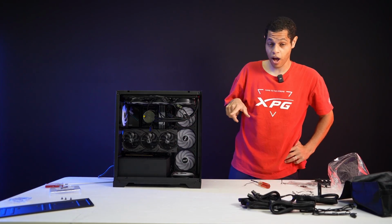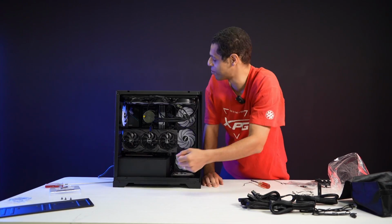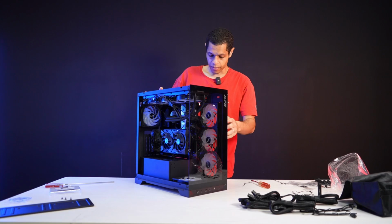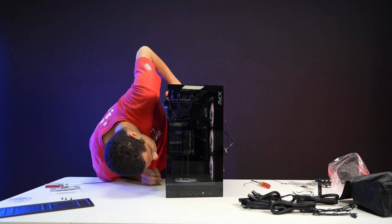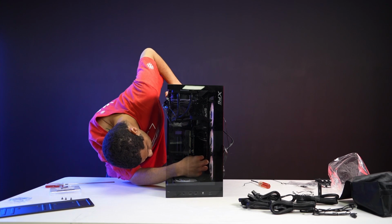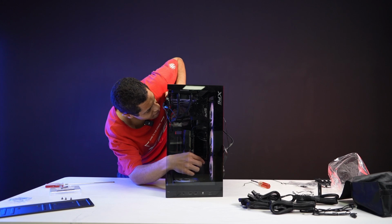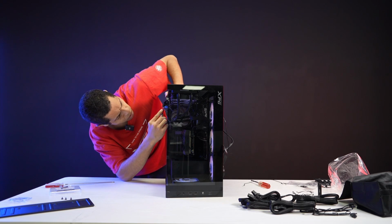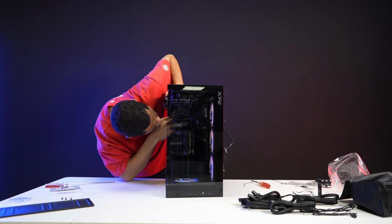All right. So you saw it's working. It turned on, it spun, fine, but I have clearly messed something up. And I don't know what that something is. So let's see if we cannot figure that out. All right. Let me think about it. Oh, God, I cannot get to those now with the GPU mounted like that. I want to say that the reset and the power are reversed is my theory. As far as the RGB fans, though, I don't know. Although the fan power is all working, so that's fine. But the RGB was wrong for some reason. Because none of the RGB was working.